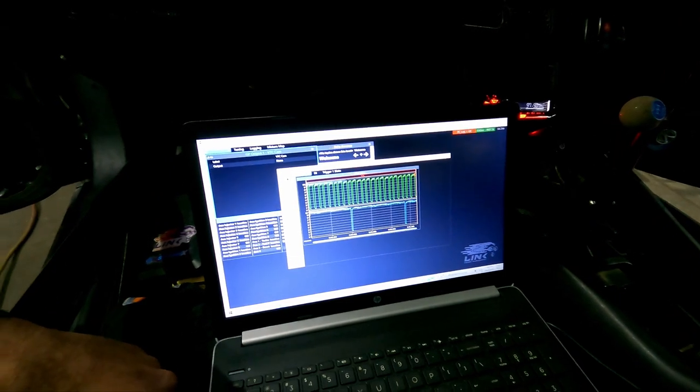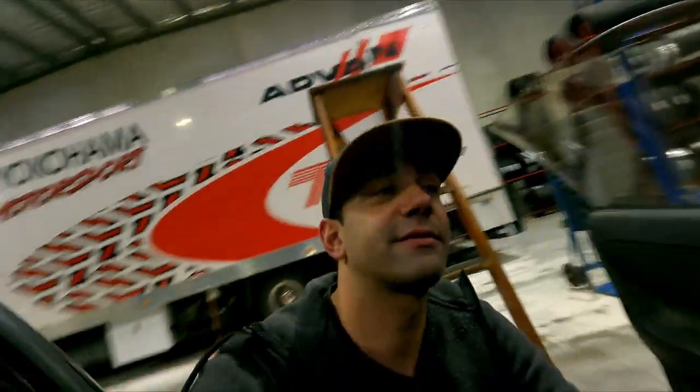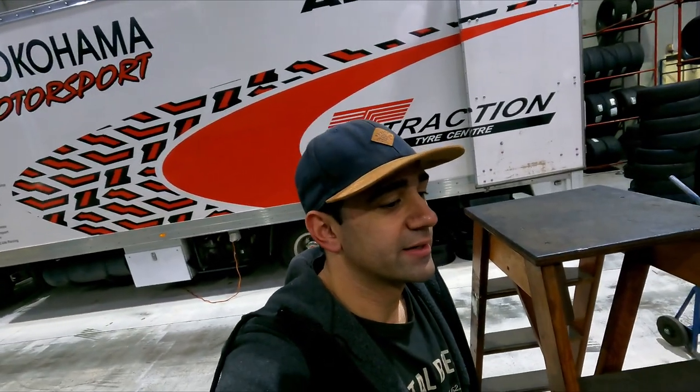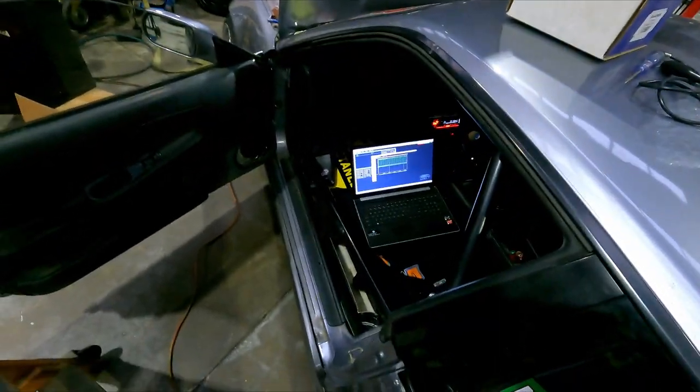So as long as there is nothing else we've missed diagnosing what's wrong with it, I should be able to put this rocker cover back together and plug everything up. If I have a new set of plugs, I'll put a new set of plugs in now, because those ones should not be gapped to 0.2. We'll go back to our 0.6 we had in it, and yeah, we should have a running car again.